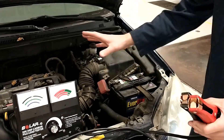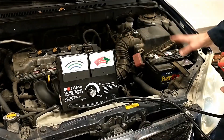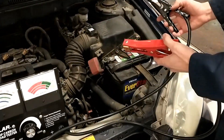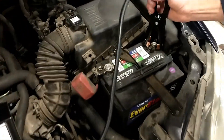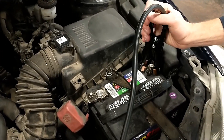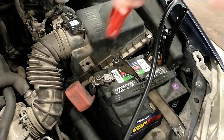In this video I'm going to show you how to use the carbon pile load tester to load test a battery. We're going to bring the tester over and connect the negative and positive leads. Make sure to observe the polarity as you connect these and try to get a good connection — it may mean you have to wiggle it around and get a good bite on that battery terminal.